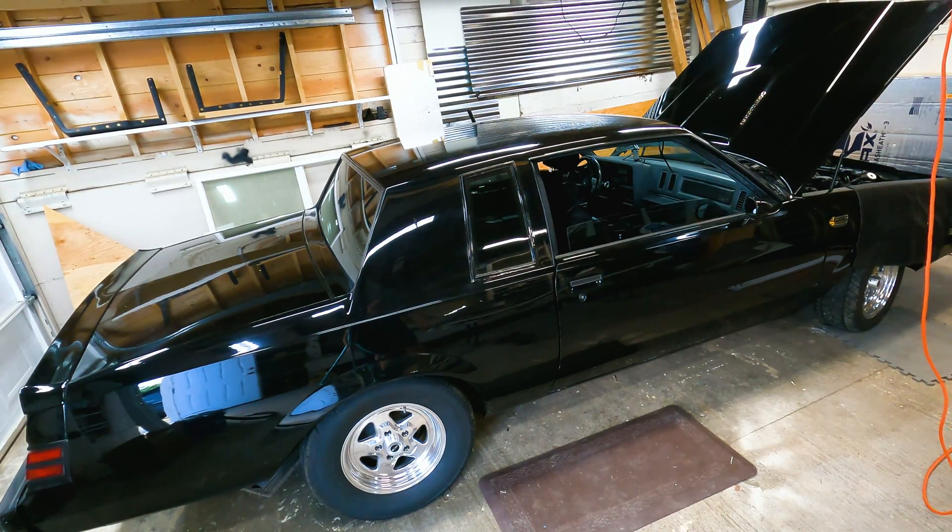If you watched the last videos, you'll know we're running that MegaSquirt ECM, but we're using just the base tune right now. We haven't done basically any tuning. I'm going to put that wideband oxygen sensor hooked up to the ECM finally. We're going to see that data on the ECM, and we're going to use that oxygen sensor to let the ECM do some of this automatic tuning.